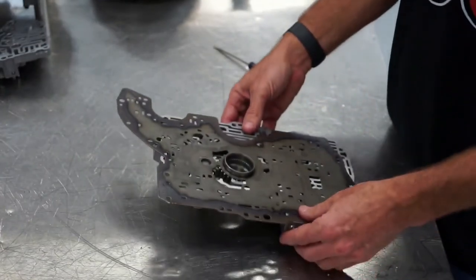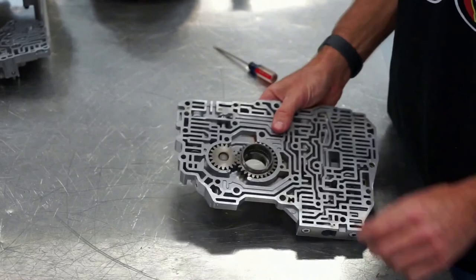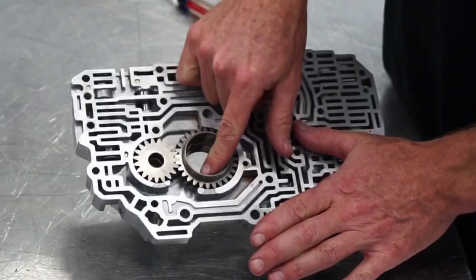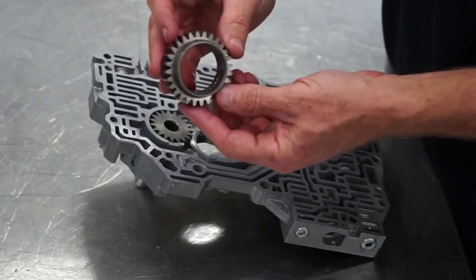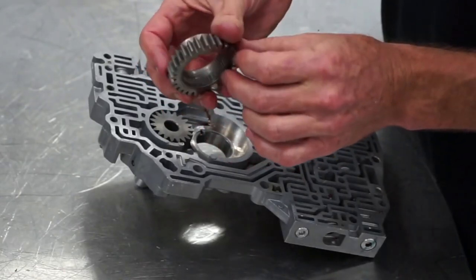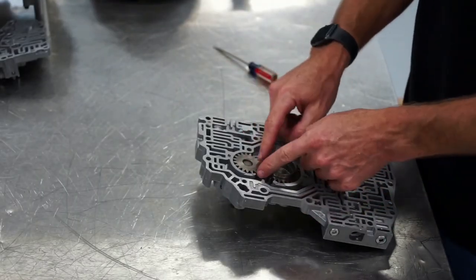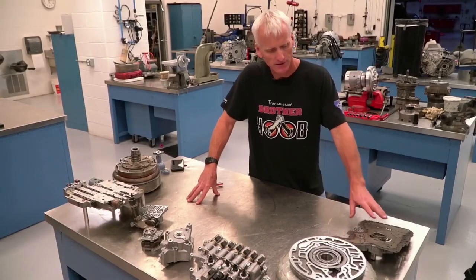This chain-driven Honda pump is similar to another design here — a gear-driven pump where the torque converter grabs onto splines on the inside of the gear. Start the engine up, the pump starts spinning, it sucks in fluid from one side and squeezes it out the other side. So there's a variety of different designs out there.